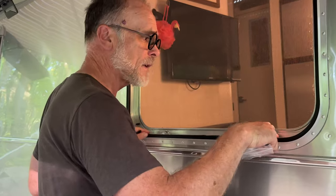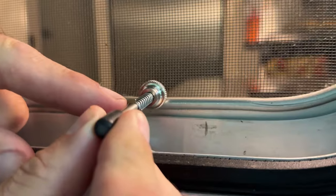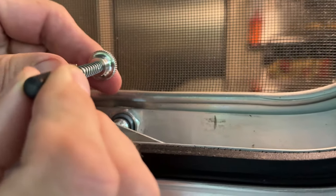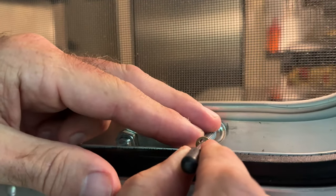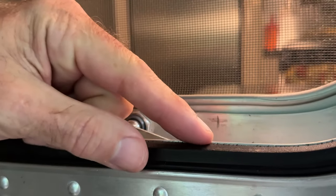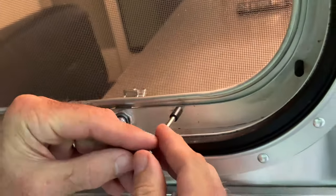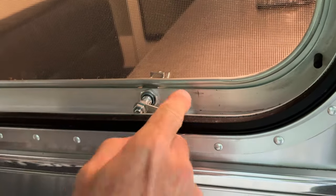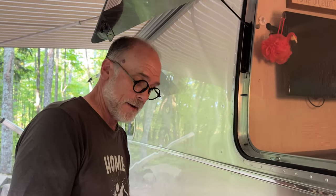Following their instructions, I've already marked a couple of places right here. I put a little plus right there because we want the pins mounted in this way, with this side being inside the Airstream — this stops them from coming through — and then the pins will push against the glass to push it open. We have to make sure they're high enough to clear this lip right here, so you've got to measure it out carefully. According to the instructions, we need to drill a 3/16" hole, so I'm going to get a 3/16" drill bit out.